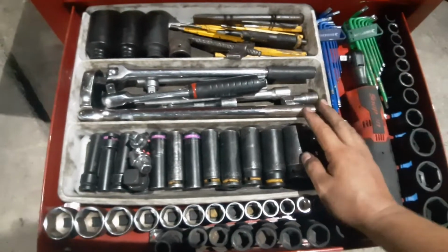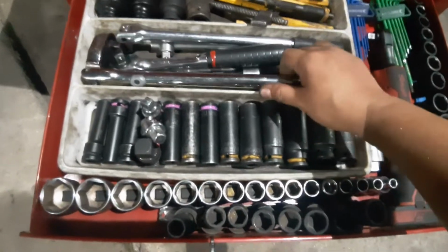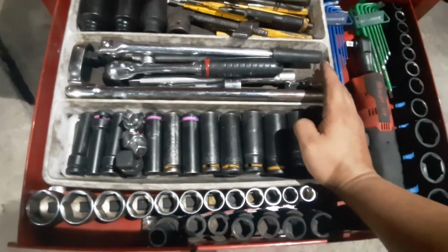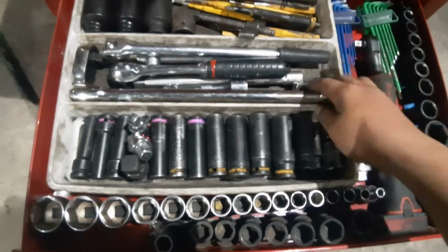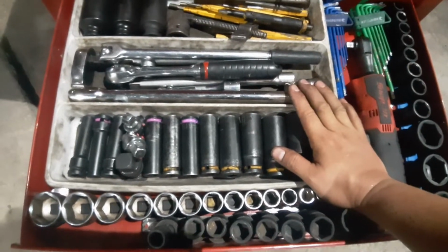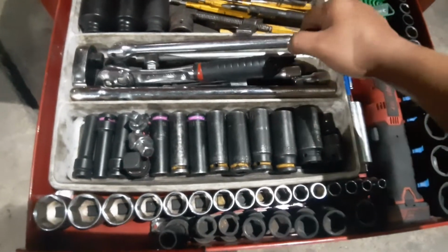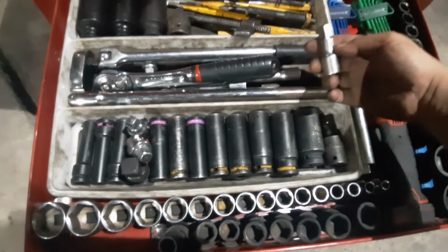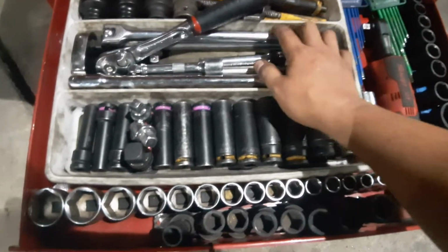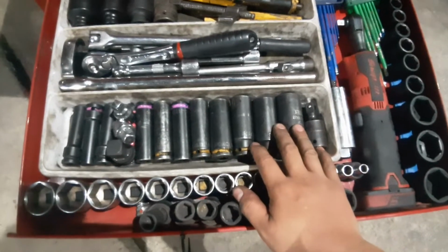Chisels, okay. Ratchets. I got myself two extra long ratchets, like 24 inch ratchets, but since I don't have an 18 inch ratchet, I just decided to cut my Snap-on ratchet and use it here. It's very good for suspension arm work, because with this one you have to put a bit more pressure, and it's better than this one as well. So: short stubby extension, wobble, and a long one. Okay, that's it. And deep impact.